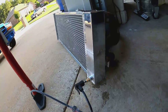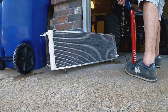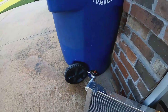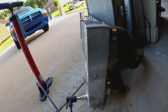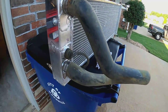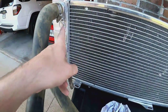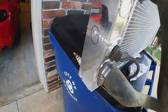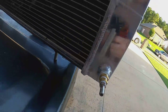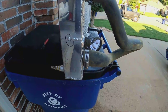Hopefully that was just a drip that was already there. We've got one leak right here. This is why it's important to check for leaks - I found three of them, and none of them were in a spot I thought they'd be. There's one right there, one right here, and one over here. I thought there'd be one on the filler neck but there's not. I'll let the pressure out, check whether there's also one on the Schrader valve, drain it, and then repair the leaks I found.